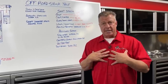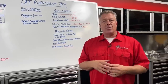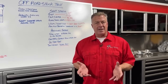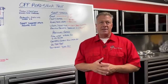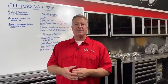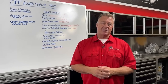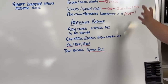Pressure balance is super important. Most garage tuners won't know what it is because you need a shock dyno to test this — and practically nobody in our industry has a dyno unless it's us, Fox, King, or Bilstein. When we go through our tuning process — setting it up for dunes, racers, cruisers, or guys with lots of accessories — all our setups are verified on dynos to confirm pressure balance within the system. Most shocks are designed to hold and function around 3,000 PSI. Get over that into four or five thousand and you'll see damage.